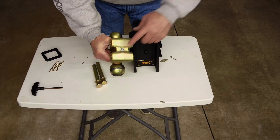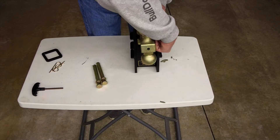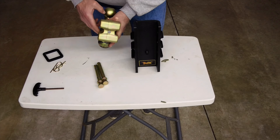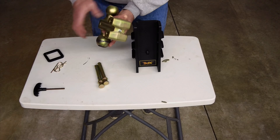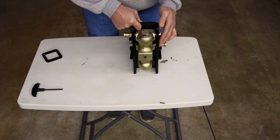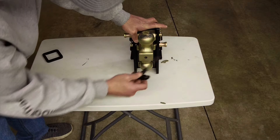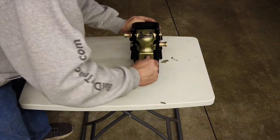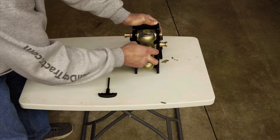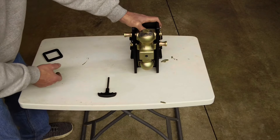One more key piece: there is a silencer screw on the ball hitch to stop the ball hitch from rattling around. That was one thing I missed the first time I used it before reading the directions. So now we're going to make sure that the hitch doesn't rattle — just come in and screw it in. And just like that — no wiggle, no wobble, no nothing. I can see that also helping to take up the slack so there's not that shock load on these pins. That's a pretty big value.